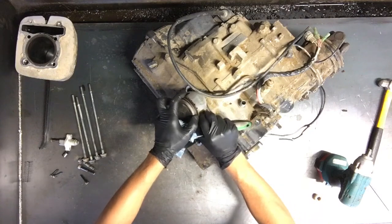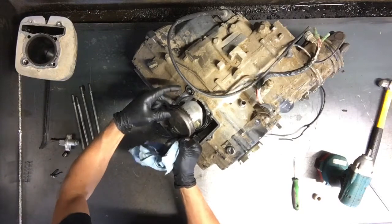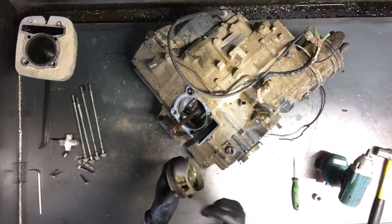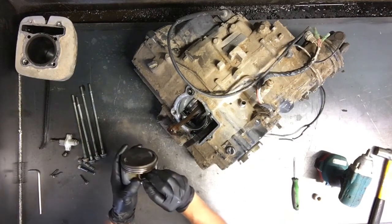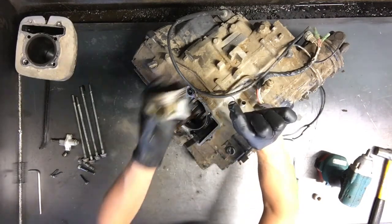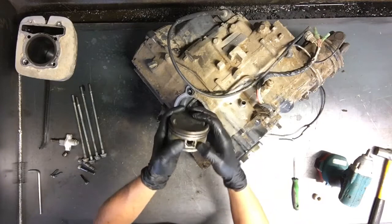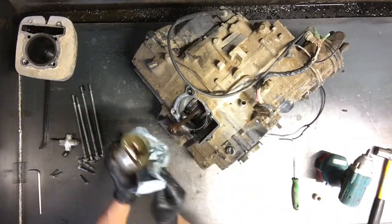Pull one side off. If the cylinder's in good condition, a lot of times this piston pin will just slide out. They're not pressed on or anything, they're just supposed to slide back and forth — so sometimes they'll get a little bit of a groove. Now to put the circlip back in, the piston pin circlip, take it this way here so the open side goes in, shove it into the groove and then just push down just like that, and it'll slide right into place. So the piston is in great shape on this one.